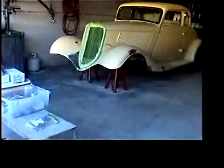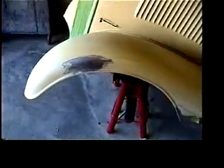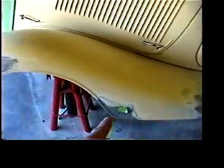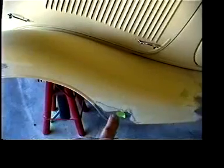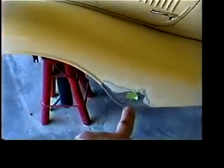The 32 Ford. And today what we got going on it is a little bit of lead work. This car has all smooth, it's got the smooth look. It doesn't show any fasteners, and so we had to weld studs on to the back sides of the fenders. And where those are attached, we're going to go ahead and lead, because lead won't crack under pressure. So we'll be able to fill that spot.